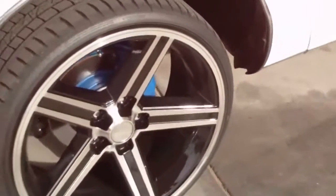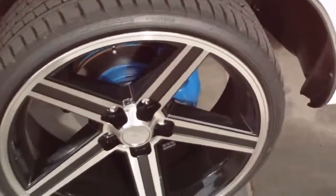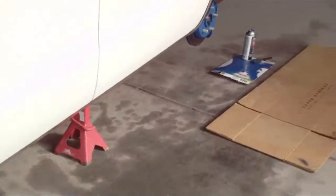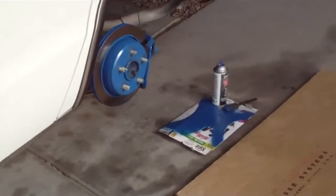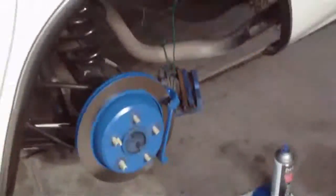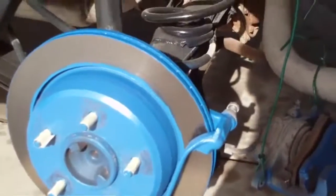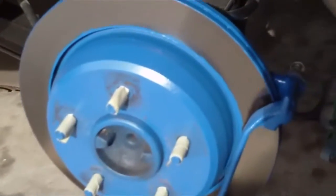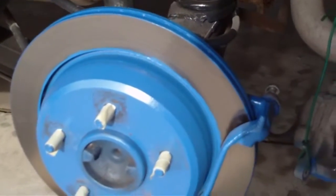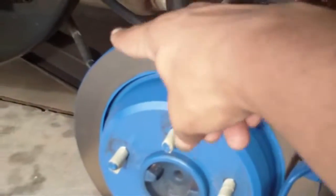So although I won't be doing the front this weekend because I just don't have the time, once it was brought to my attention that those pins weren't supposed to be sticking out the back of my brake caliper, I knew I definitely had to fix that this weekend. In order to push them back in, I knew I had to take the brake calipers off. So I said, well, if I'm going to do all that and now I can spin this freely, I'm going to go ahead and paint my outer edge.